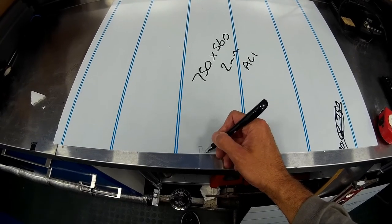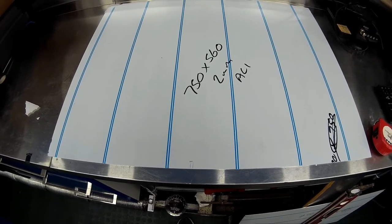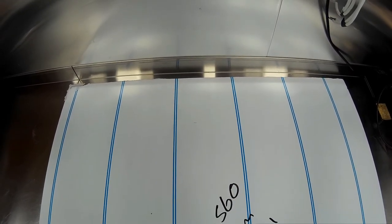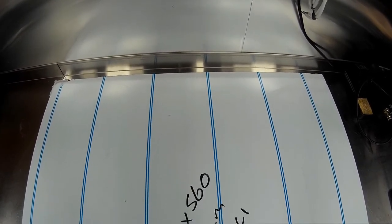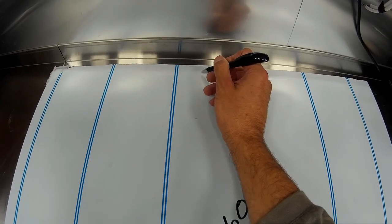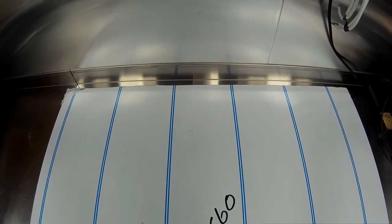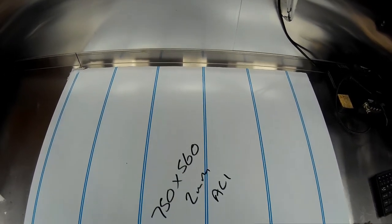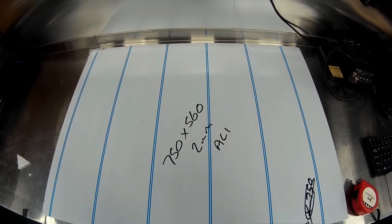The bottom piece will be folded over completely flat, offering extra rigidity at the bottom of the radiator. The top line will be folded to 90 degrees for where the shroud comes across the top of the radiator once fitted. The remainder will then be folded approximately 45 degrees towards the radiator to make a nice neat lip and offer extra stability, and once we've done that we'll mark out the locations for the fans and the expansion tank bottle.